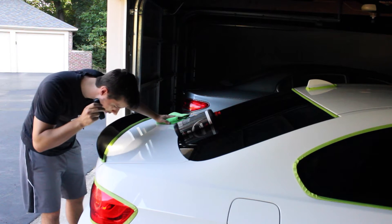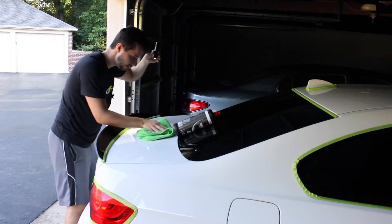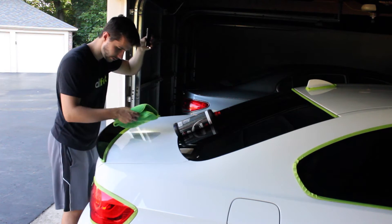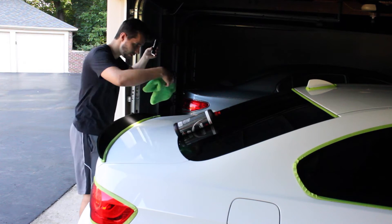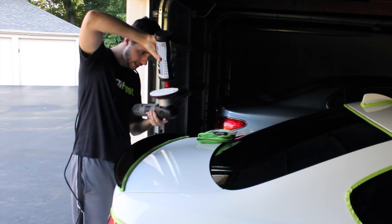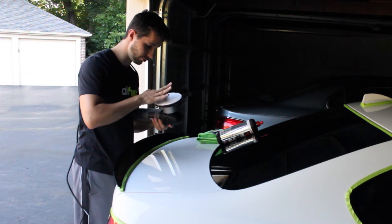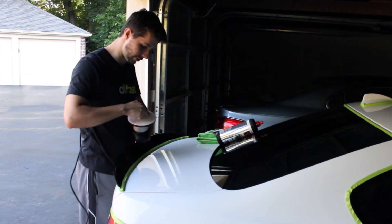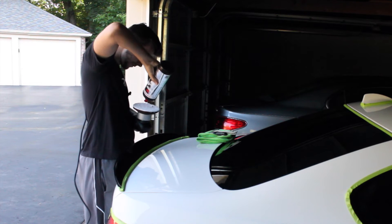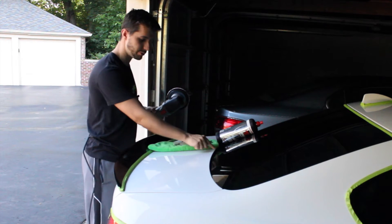Just doing an inspection — there are definitely scratches back here. I feel like the trunk is the worst for some reason. Since the car was left overnight, I just want to make sure there's no extra dust, so let's give it a quick dusting. I'm going to put probably four pea-sized dots on the first application and kind of butter it up. Don't use too much — with the Menzerna stuff, more is not better. Let's put three more in the areas I didn't get. I'll just mark off about half where I'm going to stop.